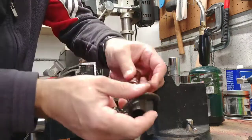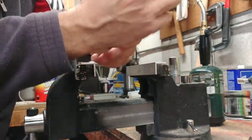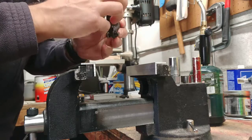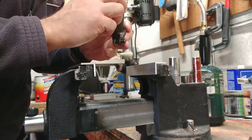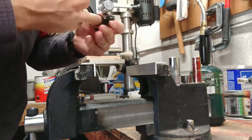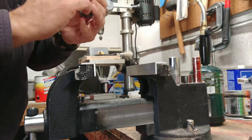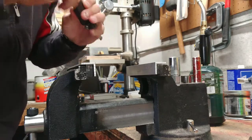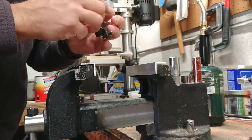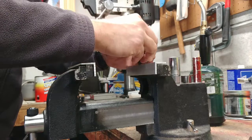So this literally just falls right through. It's the perfect length for this job. Now I have two old bearings. I'm going to hold on to those because the cages are not damaged or anything. And in a pinch, if for whatever reason I lose a needle out of one of the other bearings or something happens, the inside is really smooth. There was no bearing loose or anything, so this is flawless. I don't need to worry about it.